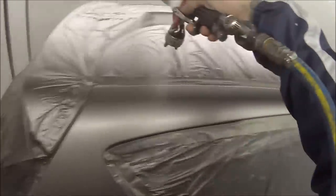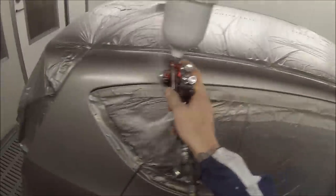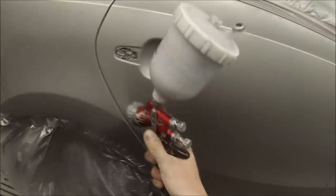As far as the actual paint work goes, you can see that the tailgate itself compared to the quarter panels has a decent size gap where the tail lights sit. So I'm able to just start at the tailgate, walk my way around the whole car, and where I come back to the other side quarter panel, I'm not going to end up getting dry spray onto anything — so I won't have to put any blending reducer over that.